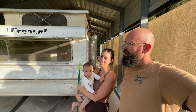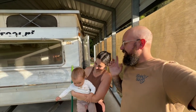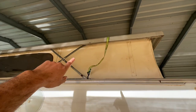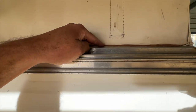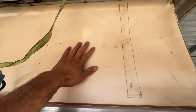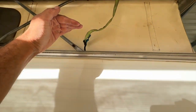I've kind of been doing everything else I can and now this is the next job to do. There's quite a long to-do list but we'll get it done. Might as well start now. To get this canvas out, it's kind of pushed in here and then pushed in from the inside, and then these screws are screwed into the rubber. It's actually really tight at the moment so I'm going to put some ratchet straps on here and pull the pop top down so we've got slack in the canvas.